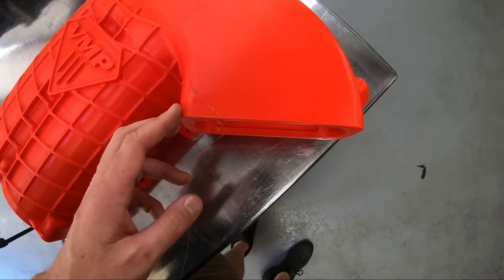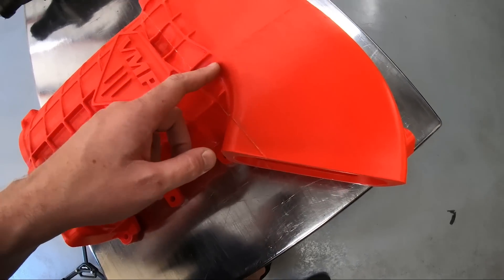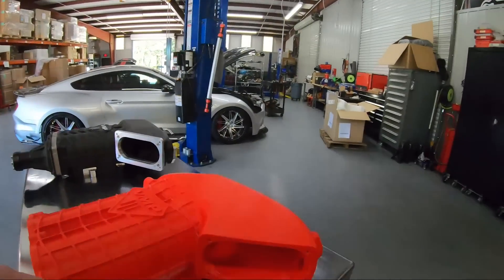Did we just go back to the stock opening just to make throttle bodies easier to bolt on? Yes, but there was another purpose as well. We were able to get a much better short turn into the rotors by using a narrower throttle body pattern. This turn right here is really critical — how you wrap the air into that inside rotor really determines how much power, boost, and flow you're going to get out of the supercharger. We were able to optimize that with the Gen 3R design. Honestly, the only thing that's the same as the old Gen 3 is the rotors. We've made so many improvements that the dyno results are going to be completely off the hook.